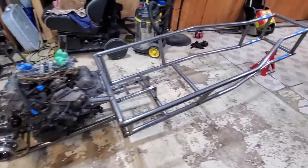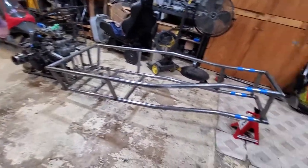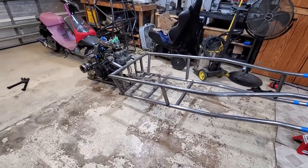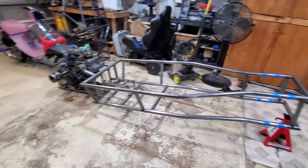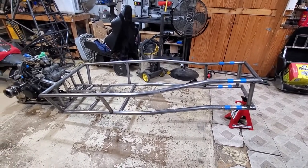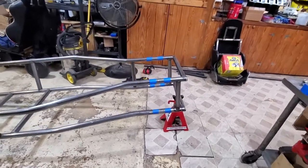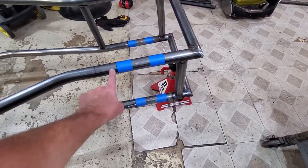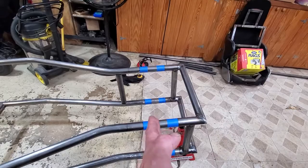Man, it's already doing wheelies and it ain't even running yet. So before I end this one off, the last thing I'm going to do is shorten the frame. This thing's pretty long and I don't really have a plan for reverse. So the shorter this thing is, the easier it's going to be to turn around when I get stuck against some trees or something. And also it'll have a shorter turning radius. So as you can see, I marked off already on here — I'm going to take out from the outside here to this side, six inches total, and just move the whole front end back six inches.